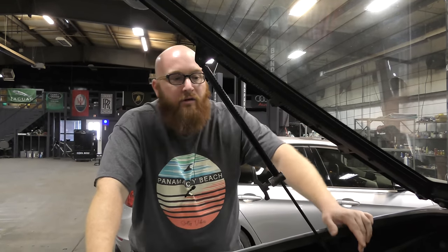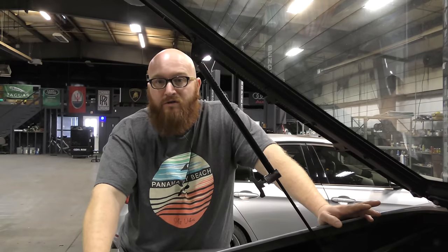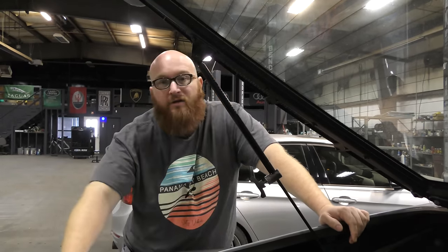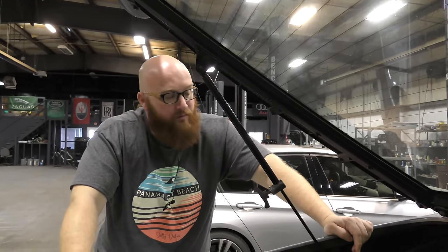We know from Tyler's Ferrari 355 there were metal fuel lines that went underneath some plastic that are covered, and there was a recall for those. You would think the original owner would have taken that to the dealer and had it addressed. No — on Tyler's Ferrari 355, it wasn't done. It wasn't caught because those panels were never removed. We never took that stuff apart and it finally burst, and that's what burned down his Ferrari. The customer wanted us to do a check over of the whole vehicle while it's in here, and I'm glad we did because we found that, and we're definitely going to address it with this car.